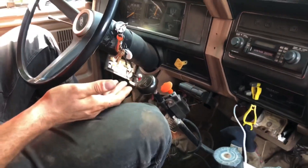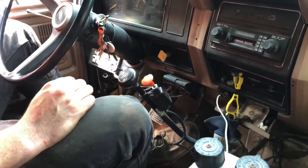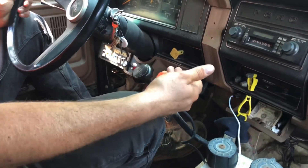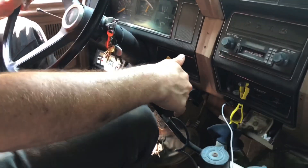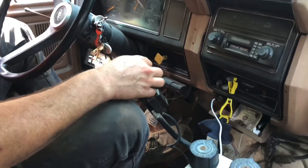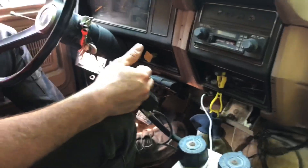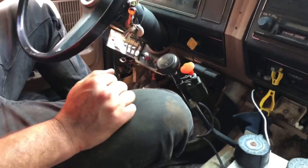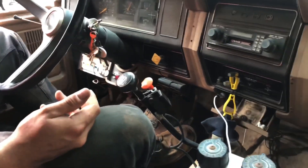If you're driving along and just go one through four, it's just like driving any four-speed truck. But if you want to split shift, you start out in first low, then switch to high, then go into second low — which would be like third — and then second high would be like fourth. So all together with high and low, it's basically an eight-speed. Correct. And you can split shift it however you want depending on how much load you're carrying.